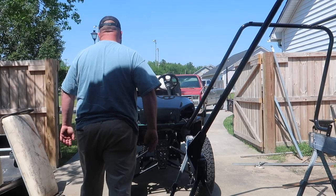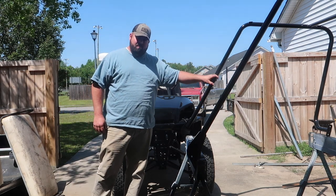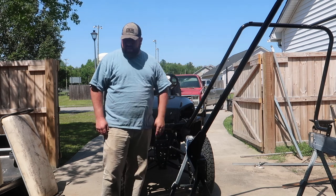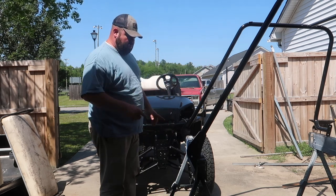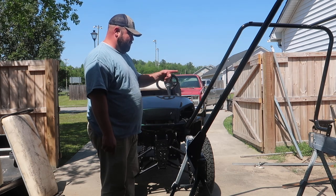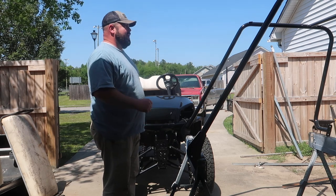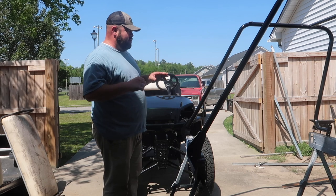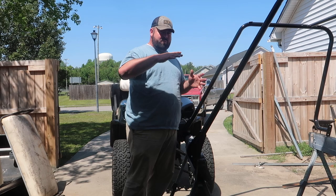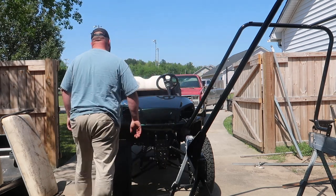So, the roll cage, or roof support, probably better terminology for that, is painted, it's dry. We got some new stainless hardware for everything. Got some 5/16 hardware, even for the rear. And I'm gonna try to do this by myself. I might try to do the back bottom bolts on it, lean it back while I'm doing those, and then slowly lean it forward since I'm by myself. Not sure, let's just see how this goes.